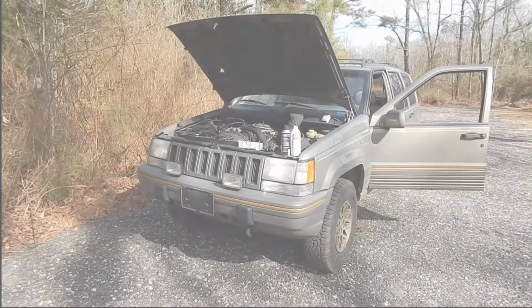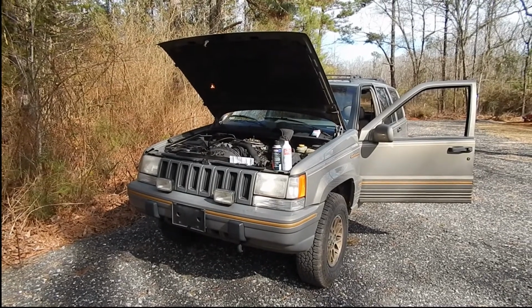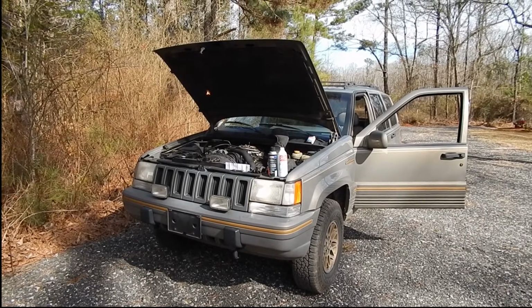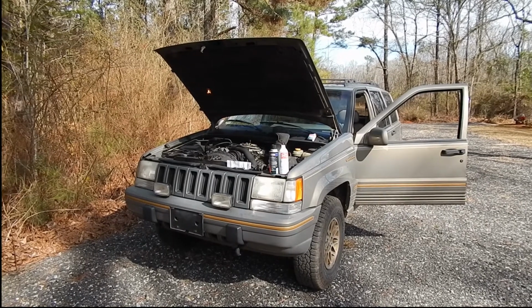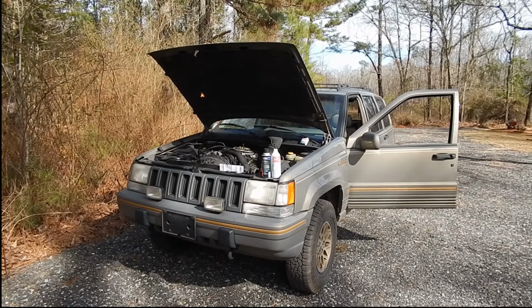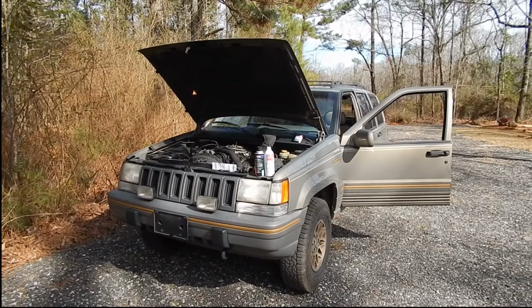Okay, this video is going to be about hard start when cold and high idle. Two problems that came up. It started off with the hard start when cold. It would crank and do fine as long as it was over 35 degrees. Under 35 degrees, it would just turn and finally catch up.